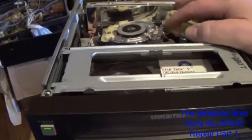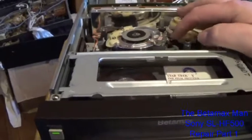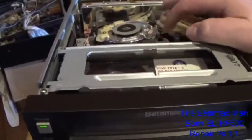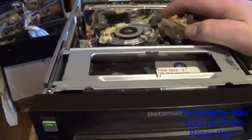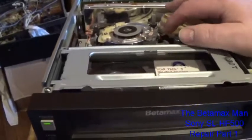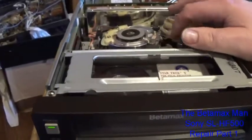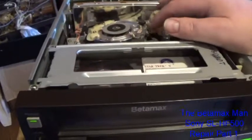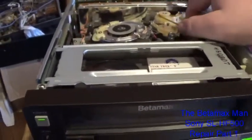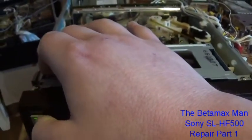There's probably something going on with one of the circuit boards. I do know that this thing has a problem with the hall effect device, because it will play a tape but when trying to rewind or fast forward the tape it is extremely slow and will hardly move.